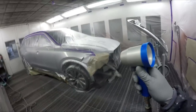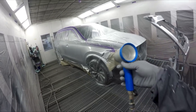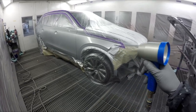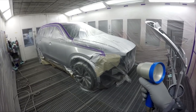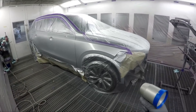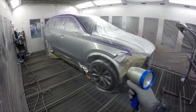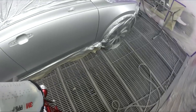Here we are drying that base coat down - I cranked the booth up to 34 degrees just to get it drying nice and quickly. Got my trusty DeVilbiss air blower here - it pumps a really nice volume of air through it so it dries it down relatively nicely. I can already see that it's just starting to flash off. One thing you do have to be a little bit careful of when you're using these blowers is not to pick up too much dust from the floor.